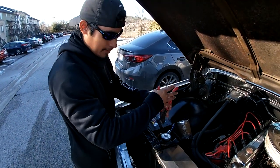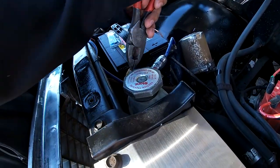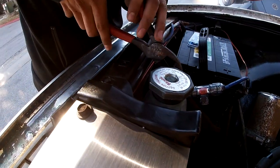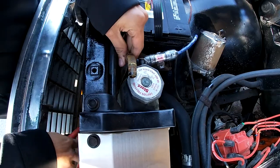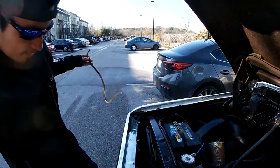We're gonna take off the clamp that's connected to the radiator. It might be a little bit hard to take off the hose because it's the original one, but hopefully no steam comes out because I just got them dry. Perfect — we got this one out. It's time to put the new one in.